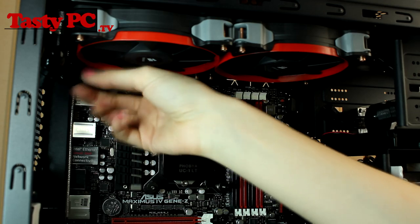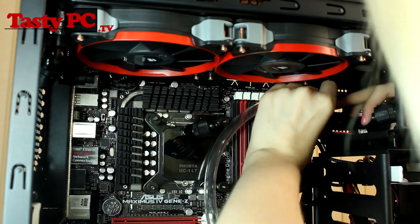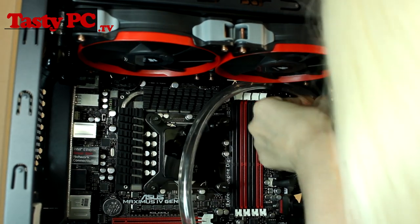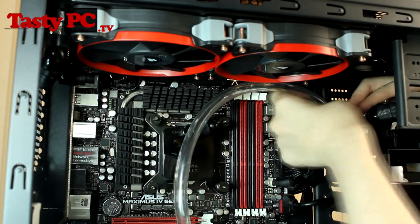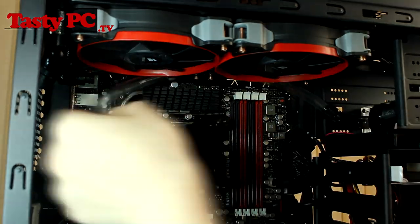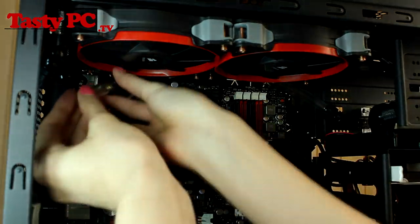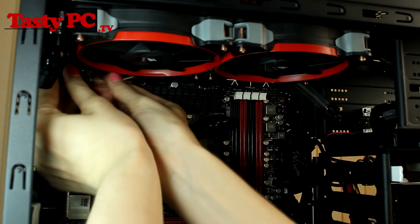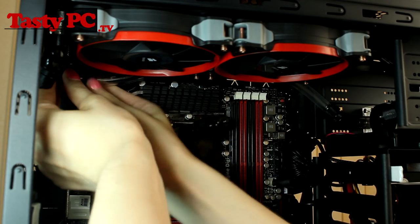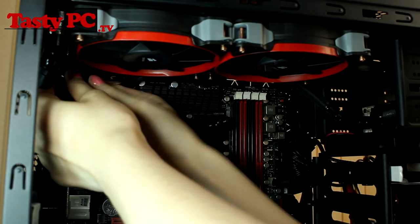Now it's time to fit the tubing. I am going to be fitting the furthest away tube first, going from the radiator to the reservoir. My plan is to try and get it tucked up out of the way as much as possible so you can hardly see it. Sometimes you do have to kind of heat the tubes up a little bit in your hands first before they will go on all the way. Luckily, the top tube does seem to be sitting at the top of the case by itself — I was actually worried I might have to cable tie this one to the top. I do want to say a really big thank you to AquaTuning for supplying all these water cooling parts, and a massive thank you to all of my subscribers for helping the channel get to where it is now.